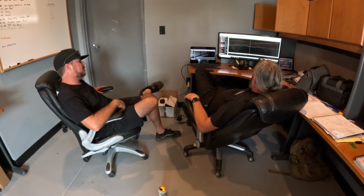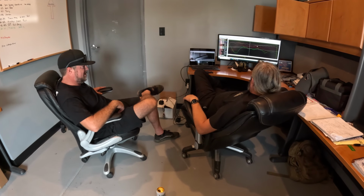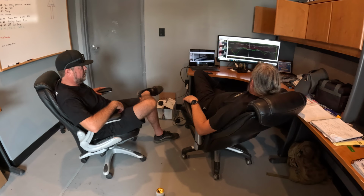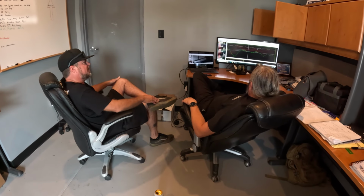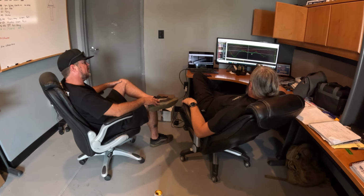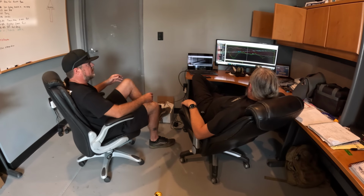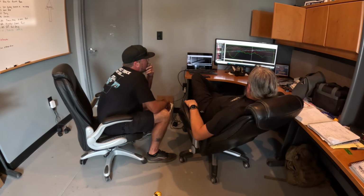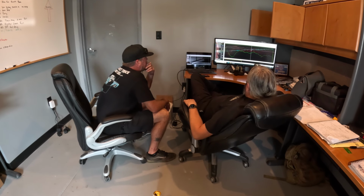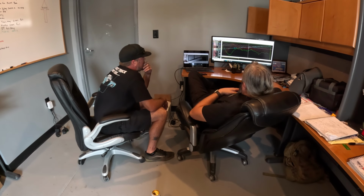Everywhere else, it seems to be pretty close. Like there's one right there, it's the blue little spot where the drive shaft speed passes the engine RPM. That would be the tires slipping. And also I have a little bit of smoothing on here. The trend is the same. So that's 59, 58, 57, 59.